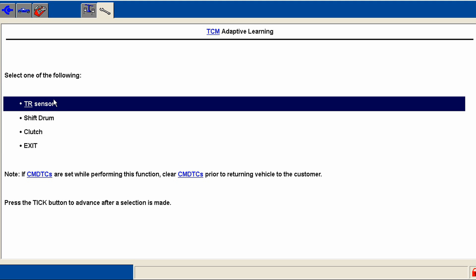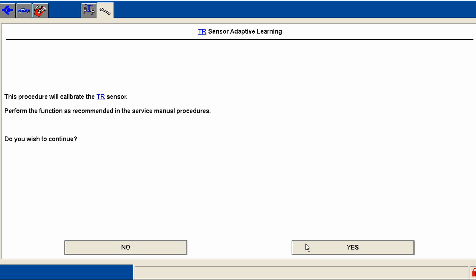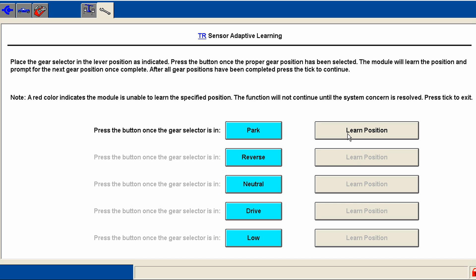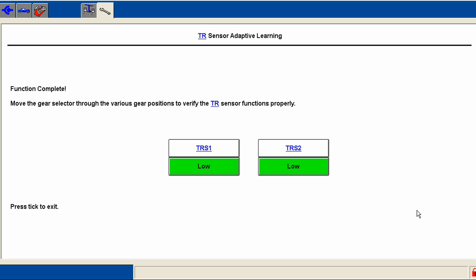You want to go through each one of these in order if you do any calibrations or replacements. We can perform it — yes — in park. So right now it's in park, we can say yes, that is my park position. Put it into reverse, make sure you're centered in there, hit it and it learns it. Neutral — same thing. It's pretty simple. Make sure you're fully in the gear, locked in and centered. This makes sure that the shifter and the trans range sensor are okay.